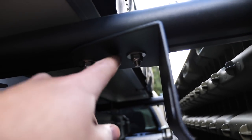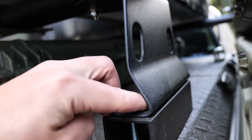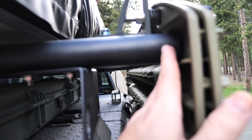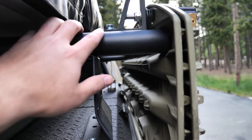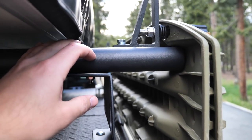You can kind of mount these wherever, but not totally, because you'll see under here there are cross members. So you either have to dodge those cross members or if you want to go through them, you'll need a significantly longer bolt. I purchased this rack system — an aluminum bar that has T-slots in it — and these things mount in those slots. I think they came in 72-inch length and I cut them down to about 65 inches. They're just aluminum so they cut relatively easy.